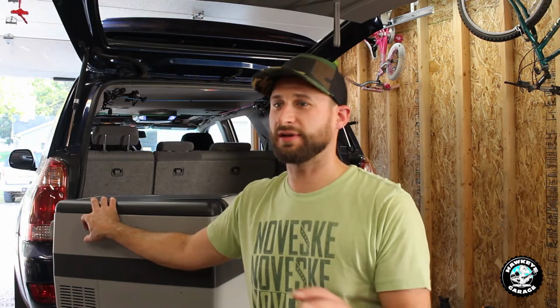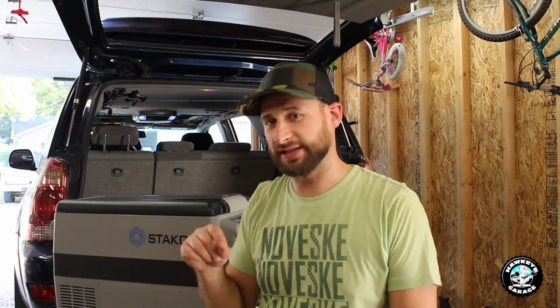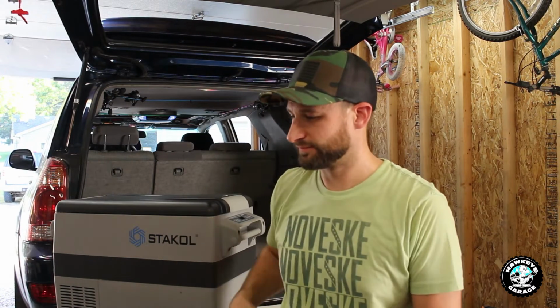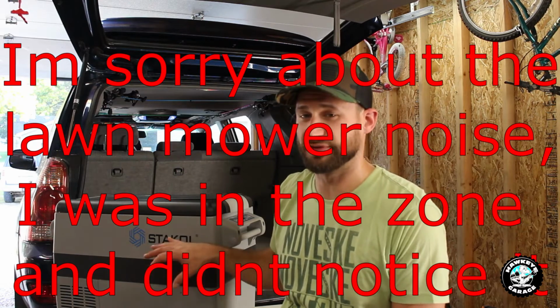Your charging system and the wiring in your car are going to be a little bit of trial and error, because some wiring systems push more juice, some have more resistance, and some batteries put out more power. I'll drop a link down to my AGM battery extra charging diode fuse hack, and I explain a little more in that video about how you can get a little more juice out of your charging system. Yes, I'm running an AGM battery for this. It just helps with the juice that this pulls.